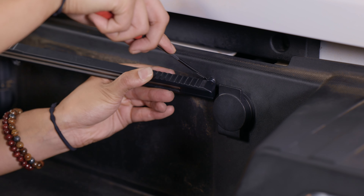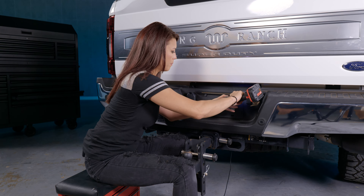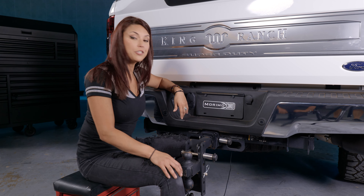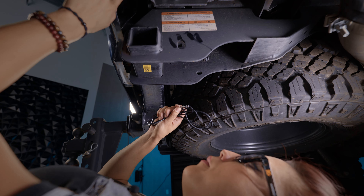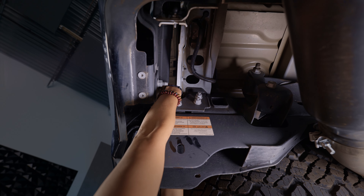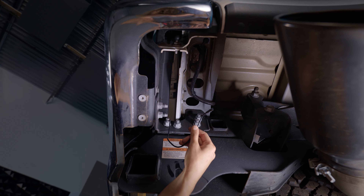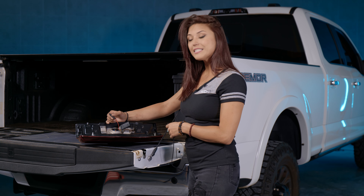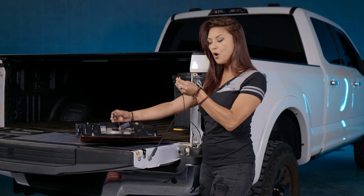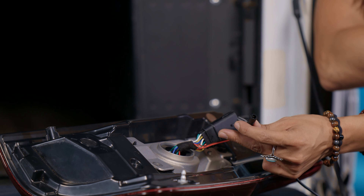Once you have it pulled, you're just going to route the wire down in between the bumper. As you can see, there's a little grommet on your light bar. You're going to pull this all the way down to your Boost Bar and then feed the wire in. You can even use a small pick just to help it get into that little groove. Now with your grommet installed, go ahead and take your license plate and install those two screws you took out earlier — no need to over-tighten those. Now let's go ahead and run the wiring up to the passenger taillight. We're underneath the truck — take the harness and run it up between the actual bumper and the frame of the truck, then route all the excess up through the OEM harness and up to the passenger taillight.